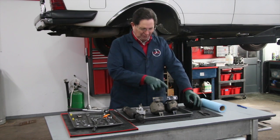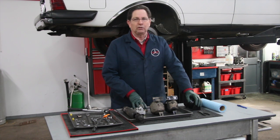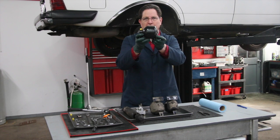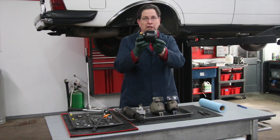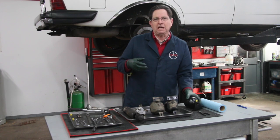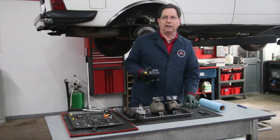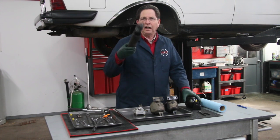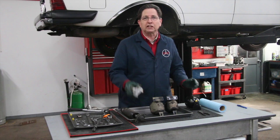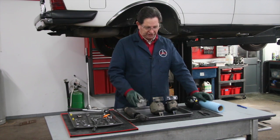You can't believe what we discovered when we removed those two old accumulators — it confirmed my suspicions. If you have one of these cars with SLS, this accumulator right here is the primary culprit of suspension problems. It's not the only one, but it's the primary one. If you neglect the accumulator balls — the nitrogen spheres, whatever you want to call them — and keep driving the car, you're going to shorten the life of or ruin the hydraulic strut. You're also going to cause problems with the leveling valve and may even force leaks through the sealing system inside the valve.